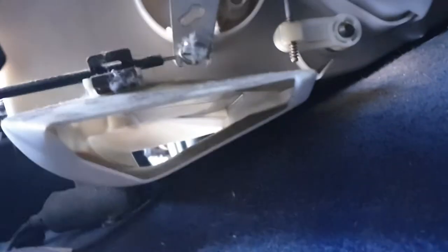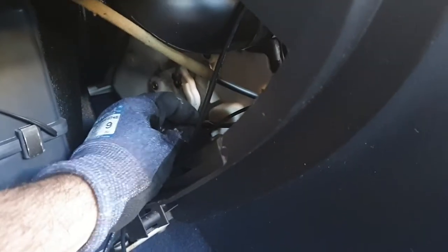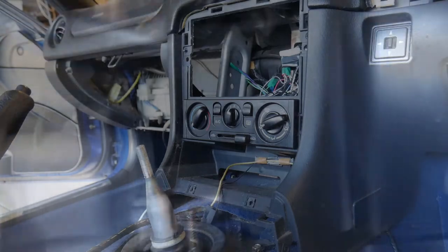It should be as straightforward as actually just getting hold of it and giving it a yank. There it is — popped off. Time to go to the other side. The left-hand side is much easier to find — you can see it right there. Just give it a generous tug and off it will pop. You'll see there's a clip just here that retains the actual line, and you need to pop that off — that was on the other side as well, but it's almost impossible to get the camera in there. You'll see that this is the last remaining hard line which you'll need to follow up — there's no way I can hold the camera and unclip this one, so you're just going to have to take my word for it that you need to unclip it.